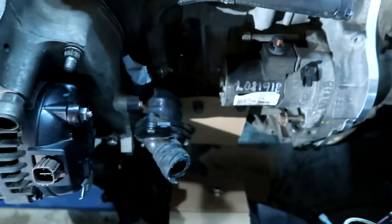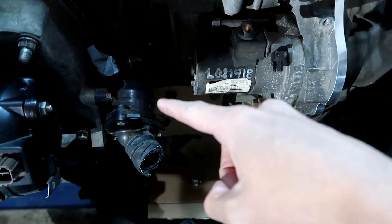Where we left off, that was building the mounts and mocking them up with cardboard. What I've got to do is really trim it because it is really bulky and we don't need huge amounts just taking up space. I had to put the water pump housing back on with the thermostat housing and the starter, because those are the things that are going to be in the general area, so I could see what parts I need to trim. I'm going to start marking and trimming to make it as minimal as possible, then copy that over to become templates for the steel plates.